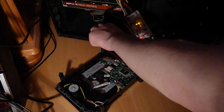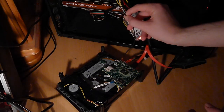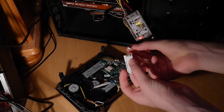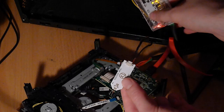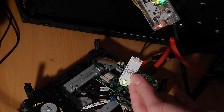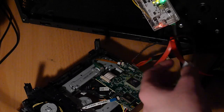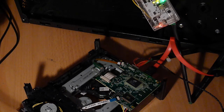Another step we have to take on the DG16D2S is to hook up the CK3 Probe 3. With the probe connected, there's no power light because we don't have power switched on on the CK3i yet. Turn the power on the CK3i now — you should see a little green light on the probe. If you're using the USB Pro, it will flash a few times blue and then be solid green on both ends. That's us set up and ready for extracting the DVD key.